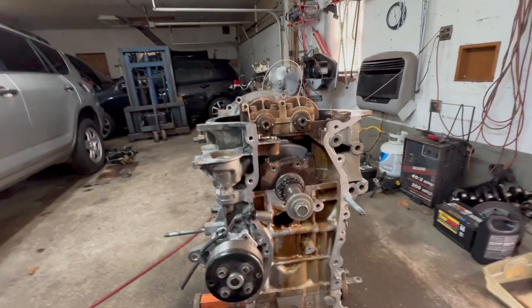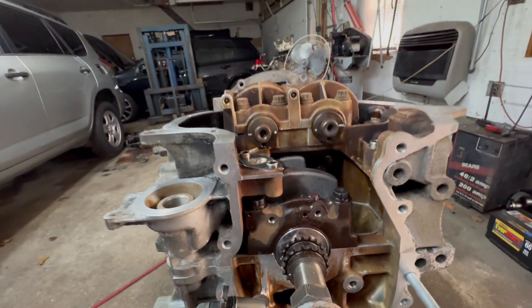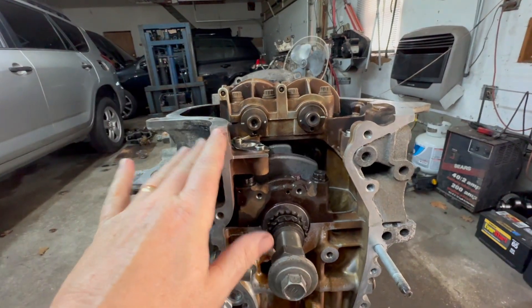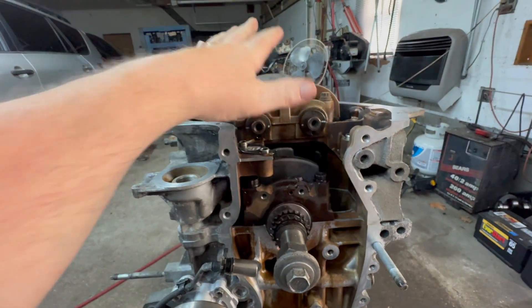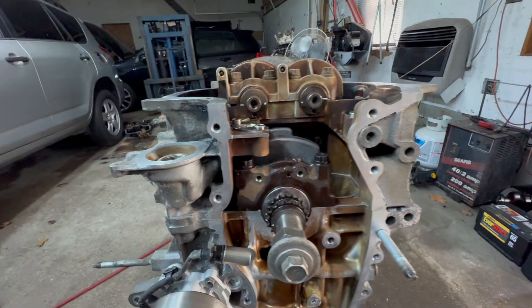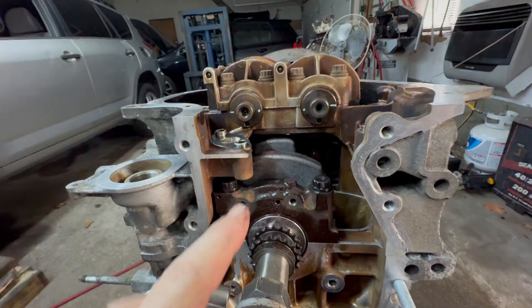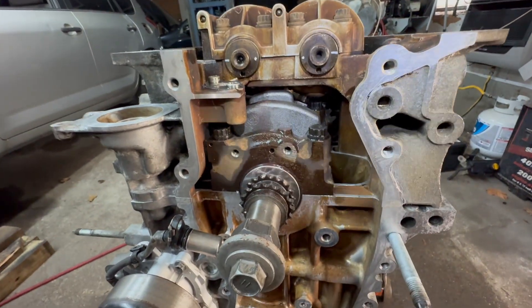Now the reason for this is because if you don't line these up when you're taking this engine apart — especially if you're taking the bottom cradle off, or the counterbalances, or you're replacing the crankshaft — the counterbalances are connected to the crankshaft.